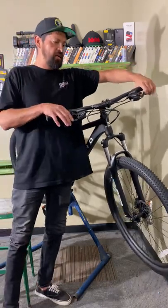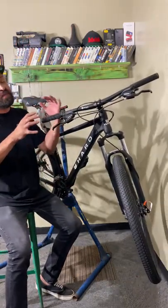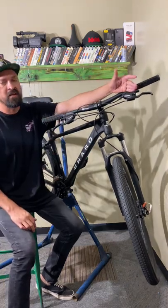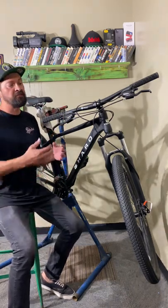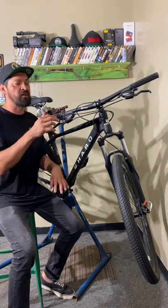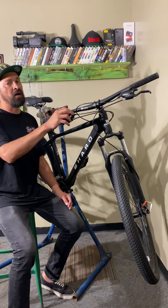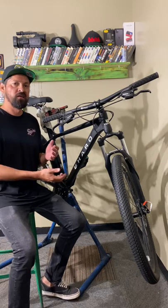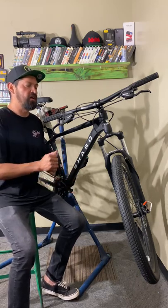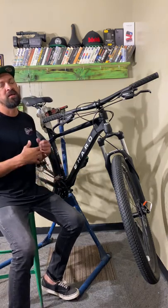So three chainrings on the left side. If you're not too sure about shifting gears, or you have a mountain bike and you're always having troubles, the best thing to do is stay in second gear on the left side — which is the middle chain ring — and then you can run through all the gears in the back. That usually helps you figure out how these gears are working. It's just like your car: you start off in first gear and go all the way up to 8, with 8 being the fastest. But when you're going downhill, you always want to ghost pedal and shift back into first gear so that when you take off, you're taking off in first gear. The bicycles need to be pedaled in order to change your gears.